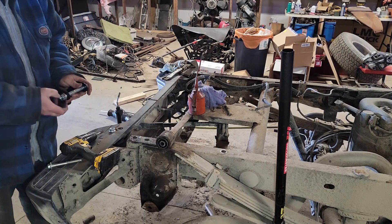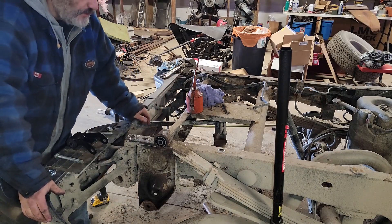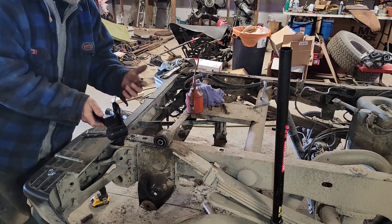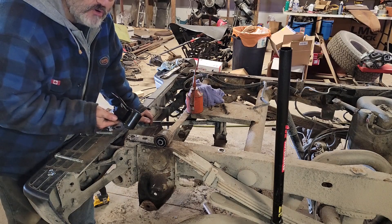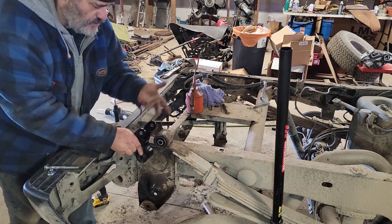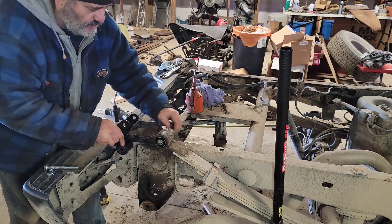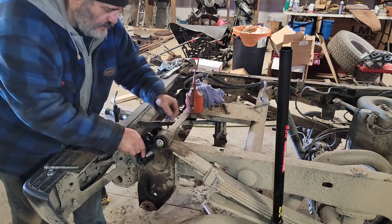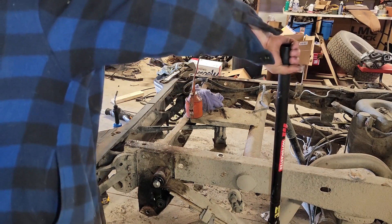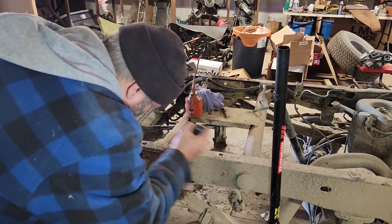Okay, shiny and new. When you live where we do, anti-seize is almost a necessity for everything if you ever want to be able to take it apart again in a couple of years — you can see what happened here, I had to cut all the bolts out. There's the part number of the new shackle if you're interested. This one's a Moog — about twice as thick as the factory one. This end goes forward. I am not putting the bolt in from the back because you can't clear the frame without cutting a hole. I'm going to put the bolt in from here and the nut on the back.